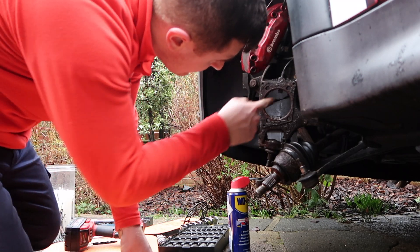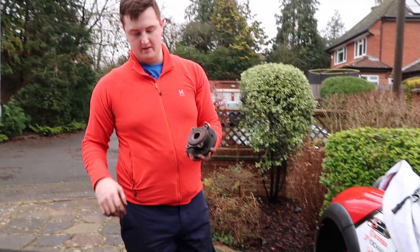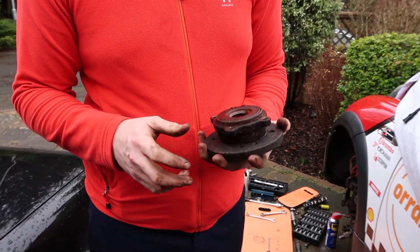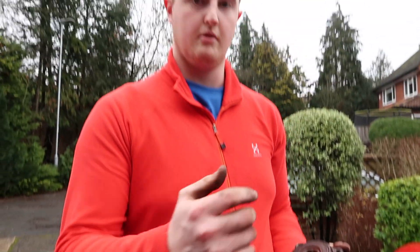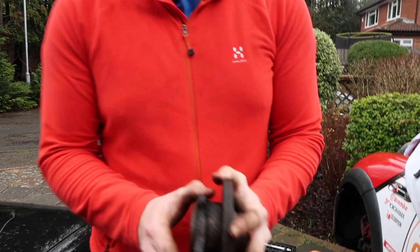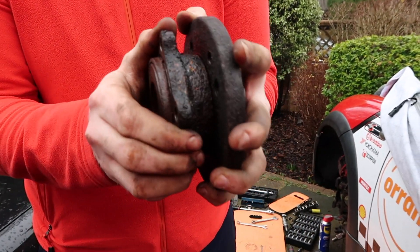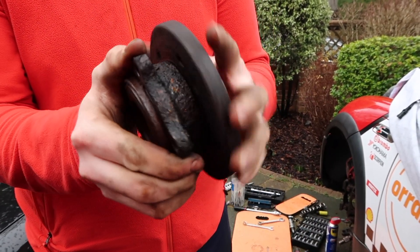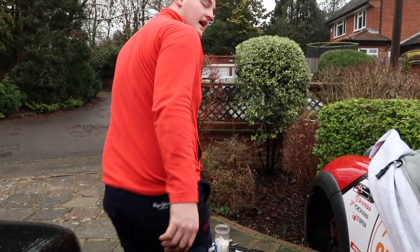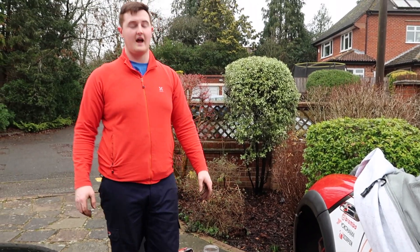Obviously I'm going to clean up on the inside. I didn't need to take the fence to that, which was good. So I just spent a little bit of time in the shed. I've got the studs out now — they're pretty easy, they're just Loctited in. We usually do them up hand tight, because the pressure of you torquing down the wheel bolts is enough. Just to show you — that shouldn't be making that noise. It's quite wobbly, and as you can imagine at like 70 miles an hour, or if you're on track at 110, 120, the vibrations are absolutely insane.